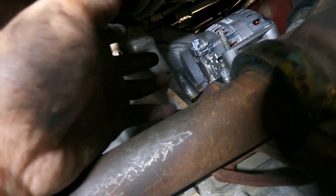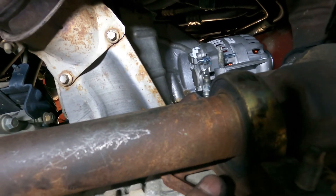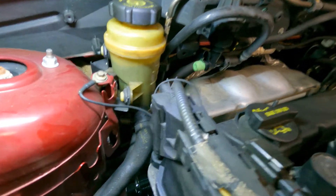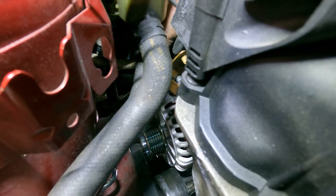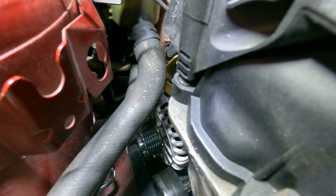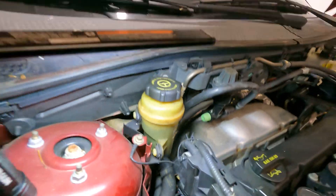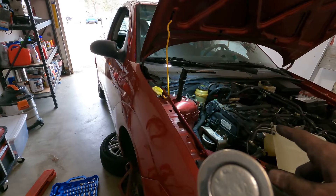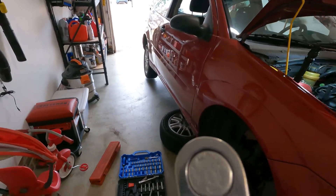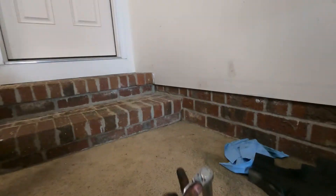Getting the connectors in, the heat shield in, and we should be done. I need to remember to put that back together. What I recommend is just hand-tighten the top bolt to line it up, then go to the bottom and put those in and tighten from the bottom. The reason is there's one bolt that goes directly into the bracket, and if we fully tighten from the top first and it shifts a little, we could strip it — and that would definitely not be good.